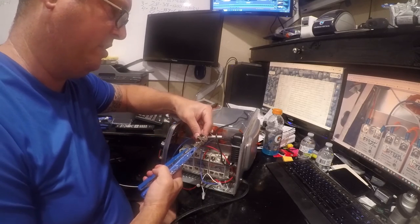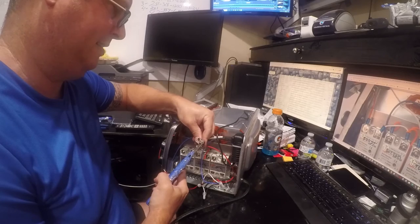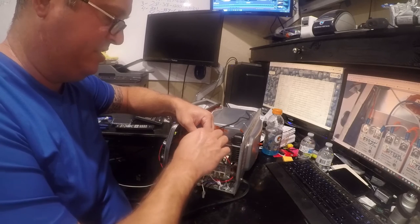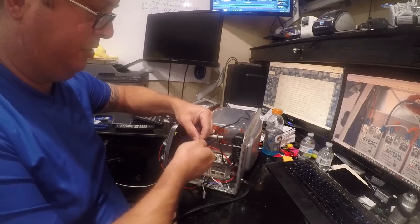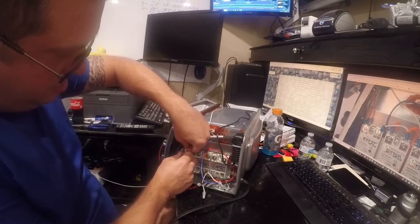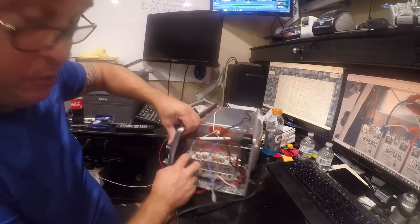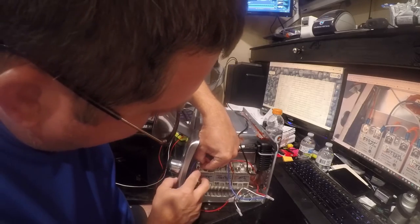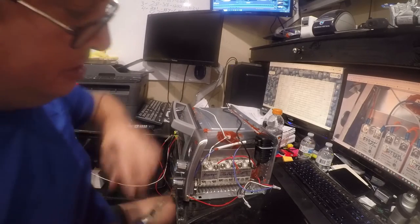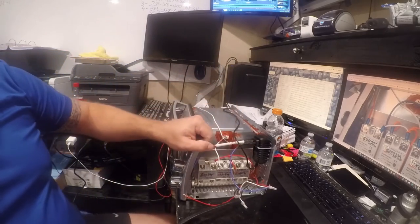Now, there are different schools of thought on wiring. My belief is that fewer crimp-on connectors is a better connection. So, I'm going to wire this the way I would wire household stuff because I think that is better, and I'm not really interested in cheaper, faster. You know, crimp-ons to me are for prefabricated assembly and speed of installation.